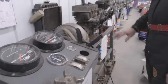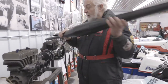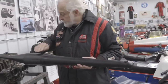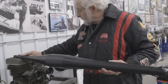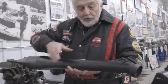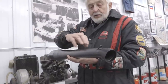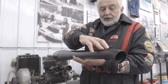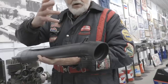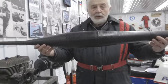That way, when you're designing a pipe, and this is even the muffler pipes that they do nowadays, they usually design it in five stages. You got your first stage, your second stage, your mid-center section, fourth, and the fifth. What this does, it brings it up here and goes down here, and then it forces the fuel back. It sucks the unburnt fuel out, but then when the fuel comes into a two cycle, it comes down here and this forces it back, so it makes a proper seal, just like a valve in a four stroke. They always make a pipe straight like this.